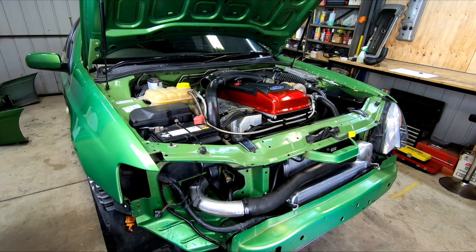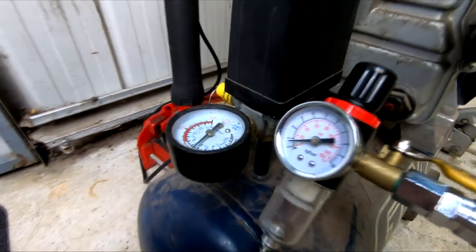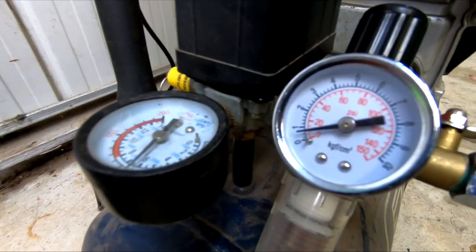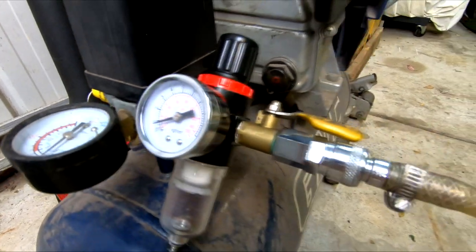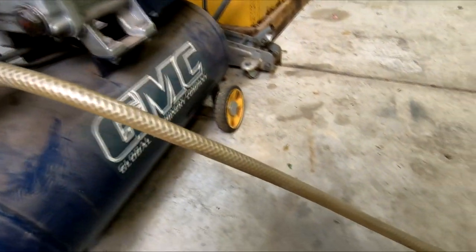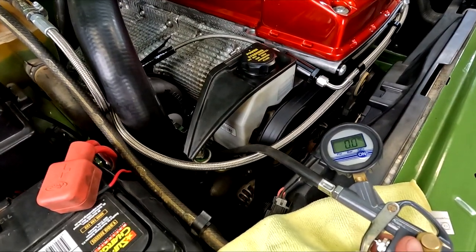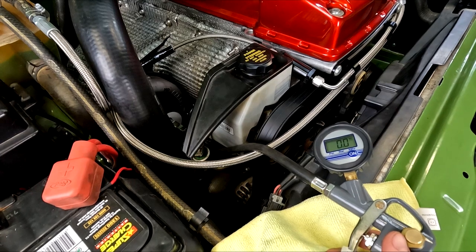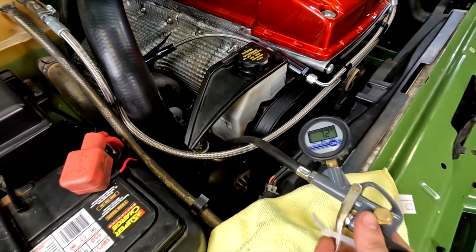Another caution is to not overpressurize the system, but make sure to check the range of boost you'll be running on the car. This car is currently set up for 7 psi, so we'll start by setting the compressor outlet pressure to roughly this, and check it a little higher just to be sure. The tire pressure gauge I'm using can also give a more accurate reading, but does not set this pressure. You may want to jam the trigger for the tire gauge on with a cable tie while you run around